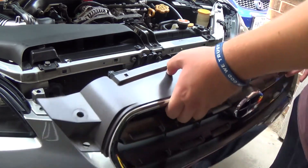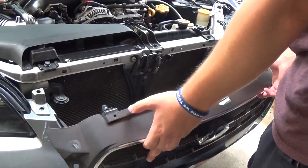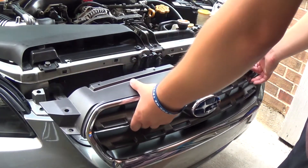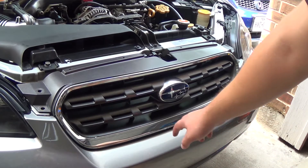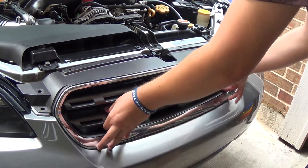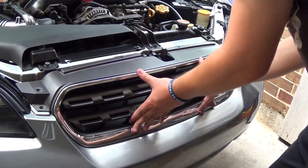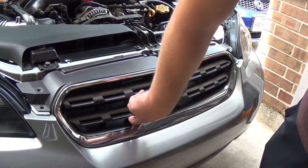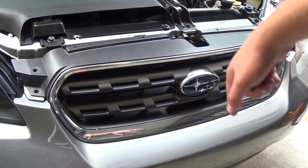To put it back in it's pretty simple, but there's a little trick to it. You don't want to put it in at an angle — try to put it straight in. When you do, make sure there's no gap down here; you want the bottom of the grille to lock in down at the bottom. Everything should click in, and to confirm it's in correctly, lift up from the bottom — the grille should be locked onto the bumper and shouldn't come up. Once it's slid back in, put your plastic pins and your two bolts back in and you're done.